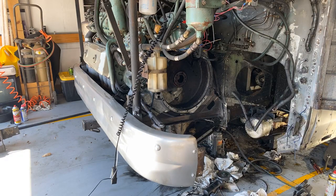The rear main seal is supposed to be here today so I can get in there and pull that out. We're putting a sleeve on the end of the crankshaft as well. Obviously this one was leaking, but even if it wasn't we would have replaced it anyway since we're this far into it. You can see how bad it was leaking — when you see a really clean spot next to something really nasty, that means it was really leaking; that hot oil cleaned it all up. A couple people are saying when I walk further away it's harder to hear — I'll try to talk louder.